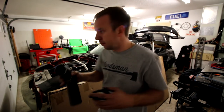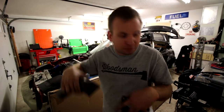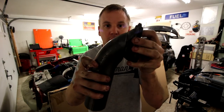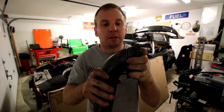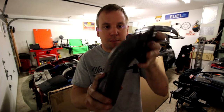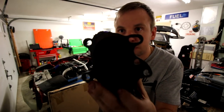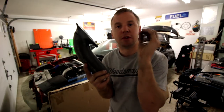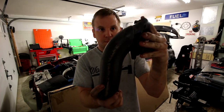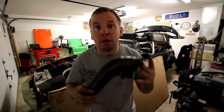The new downpipe location needs to be adjusted because of the transmission and because I fixed the back shelf inside the car. So I cut a much steeper angle, and now it drops down significantly faster. I have this set, so it's perfect. I have it marked. Essentially that will be my new downpipe. It will drop off very quickly and still have plenty of room, kind of hard to see, but exhaust should easily go straight back and down. So that is gonna be the new downpipe as it is. I'll show you when we test fit it in the car, what it looks like before I weld it all up.